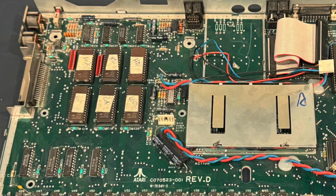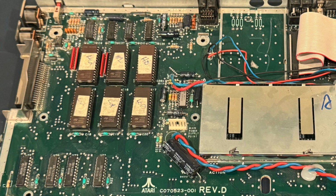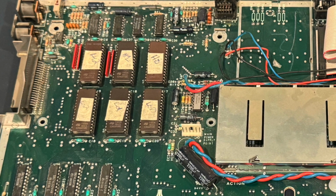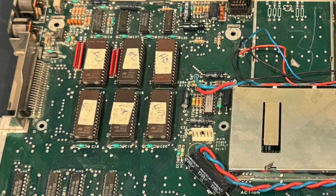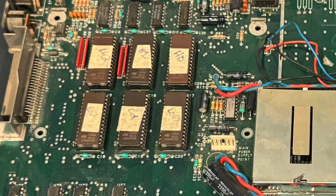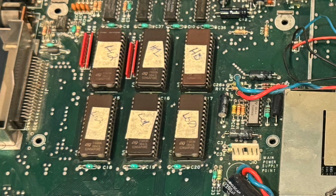There exist some other versions as well, but in general, you want to be looking for a TOS 1.04 or be able to go to a TOS 1.04 or 1.62 or higher at some point, from a compatibility standpoint as well as from a functionality standpoint. In general, the TOS 1.04 or 1.06 or higher have much better compatibility and fewer issues with the various different hard drives that exist, and then also have good compatibility backwards with the early software.